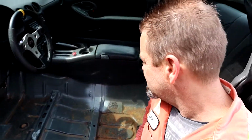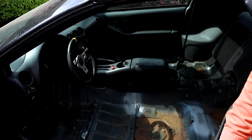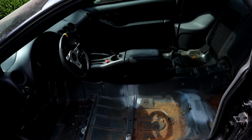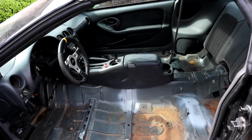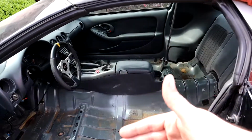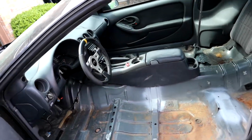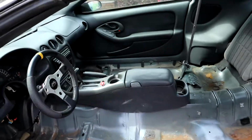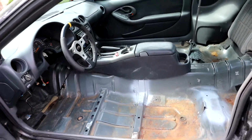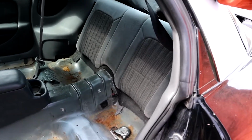Guys, if you're putting these seats in and later you're thinking about putting a cage in, be sure to think about the space where the cage actually goes next between the door and the actual seat itself, so you can adjust left to right on that. Pretty much what we did. That's why we sectioned it so much, so we can get the seat just a little bit over for that same reason. You know it's gonna have some back seats. Ain't a street car without back seats, guys.